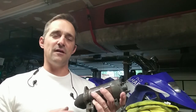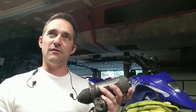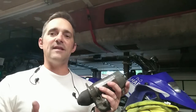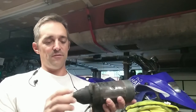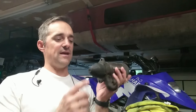What I could gather online is that the one in my bike - I have a '74 R90 Slash 6 - is a Slash 5 or very early Slash 6 starter. It kind of fits; 1974 was the first year of the R90, or was it end of '73? Very early ones were made end of '73. I guess the R90 Slash 6, especially the first year, was kind of a hodge-podge - they just took whatever they had left over from the Slash 5. And then this one here is a proper Slash 6 starter - 8 teeth on the gear. Later year Airheads had 9 teeth.